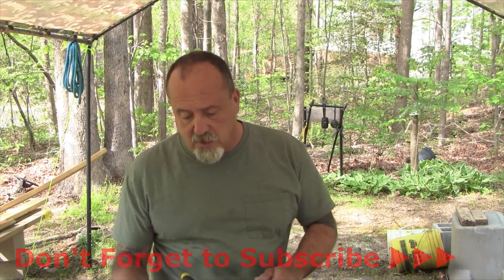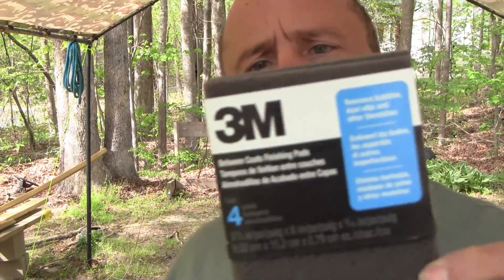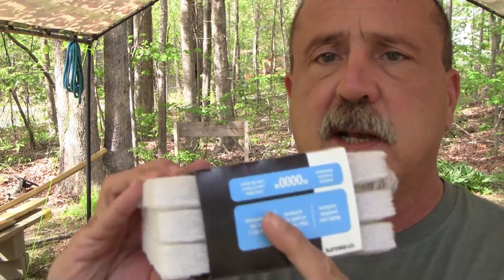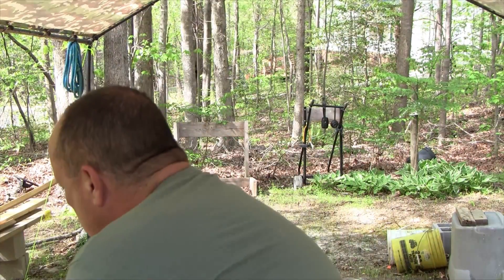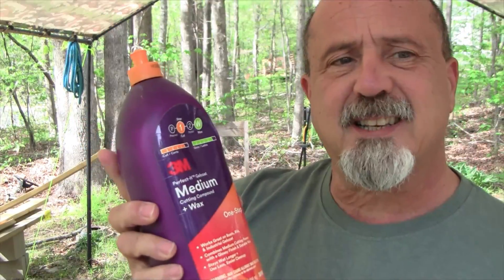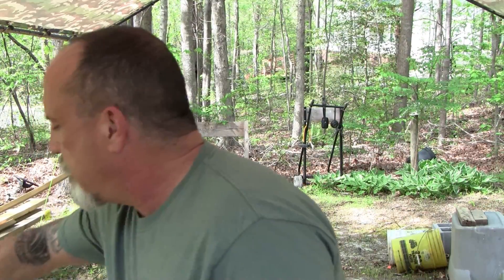Here are the items I'm going to be using. First, I'm going to wet sand it using these 3M pads — the gray is about 800-grit, the white is about 1000-grit, a quad-zero steel wool equivalent. Using these two leaves it with a little bit of shine. After that, we'll hit it with a wool buff pad and 3M medium compound — I could have gone heavy, but since it's a light coat of oxidation I'm going with medium — then finish with 3M perfected wax.